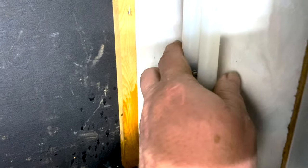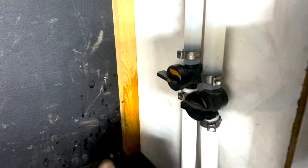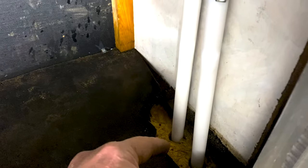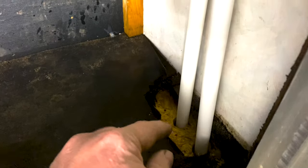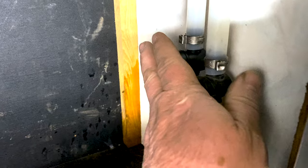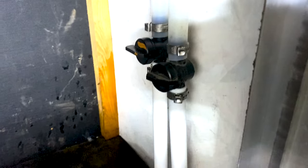Coming here, pulling out the box. These drains, one's for hot water, one's for cold water, for draining in the wintertime. They go through the floor. They were hanging down just under the camper, these drains were, so we cut them off till we got it sitting down. I drilled holes through the board, through the floor of the trailer, and put the valves inside so that now they're out of harm's way. They aren't going to be hanging there for what we're doing. So I drilled holes through the floor, ran some new PEX, and that sticks out under the trailer and it can drain.